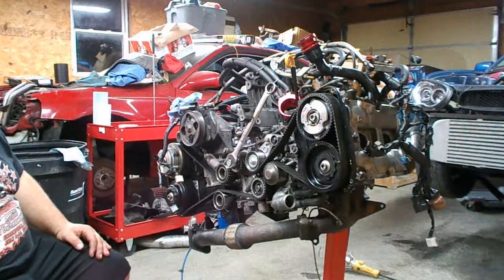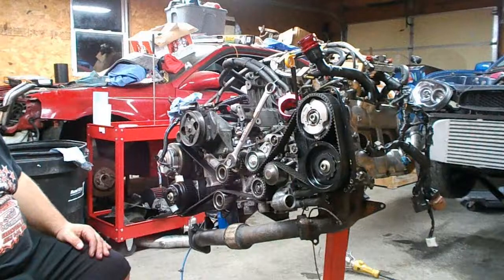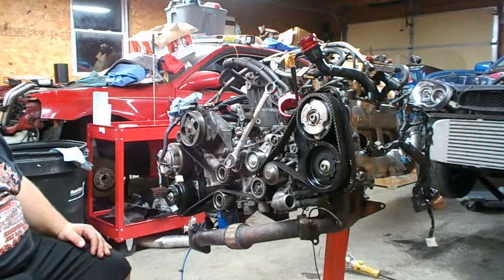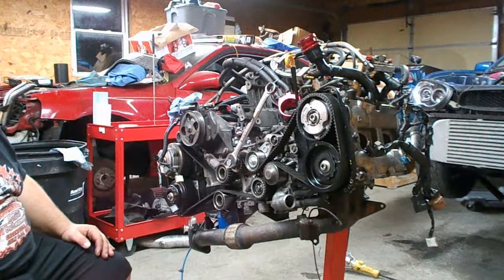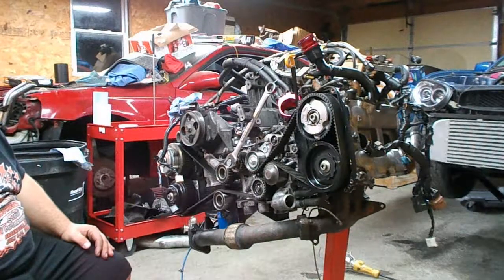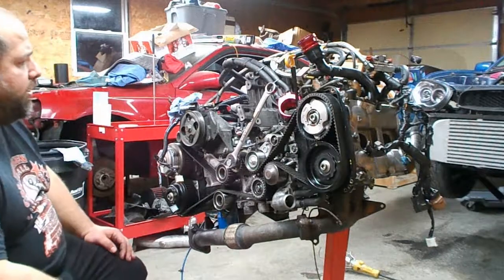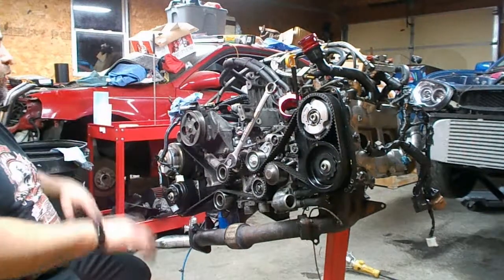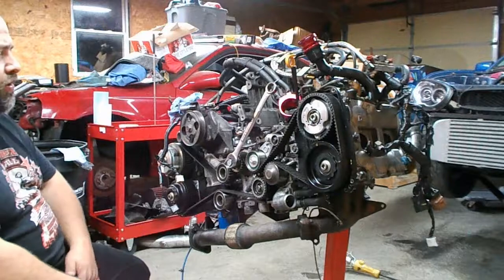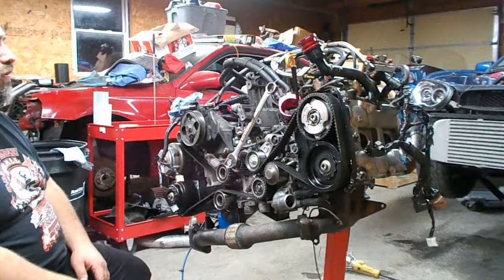I was able to get one out of the 4 bolts off, so I guess 25%'s not bad, huh? So we're gonna try to get a little butane torch and get some heat on the bolts. I don't know that we'll make enough heat with it to really do any good, but that's all we have for now, so we're gonna give that a try. In the meantime, I'm gonna go ahead and just start pulling some brackets and fuel rails and some of the other stuff off that we're going to need off anyway, so that we can just keep making progress and move forward.